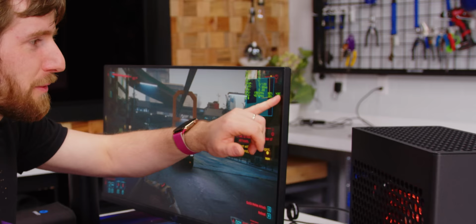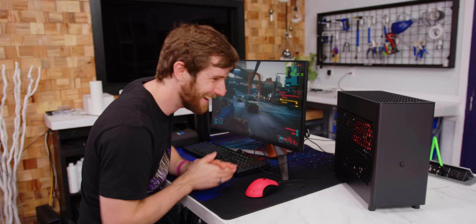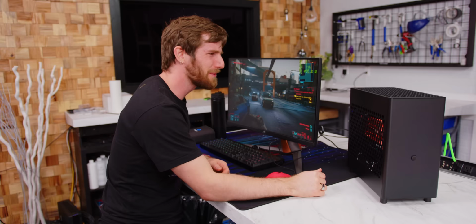Here, our GPU's at 43 degrees. Did the water cooling work? I think that's a big, fat, heavy yes. And our CPU's at 67 degrees, which is actually a little higher than I might have expected, but still easily respectable. I don't know too much about the actual design of this Barrow CPU block, so it might just not be an amazing block, and that might be perfectly normal.